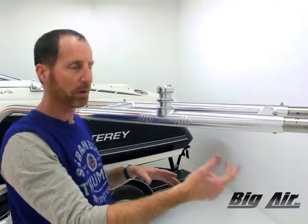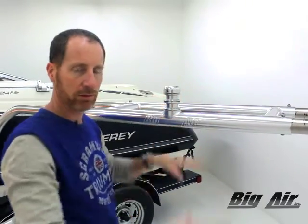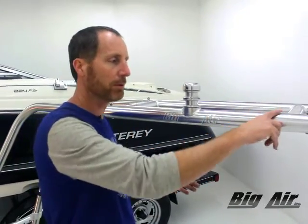A few techniques: go slow, maybe a little bit of WD-40 on your tip. Once again, leveled on the floor — as long as your mounts are level, you're going to be fine. Put the preload in. We also like our cross braces to be fairly level, and we've gone in and made marks there. When we get ready to drill, we'll tap it up and drill through here, then drill through the collar once we have it in position.